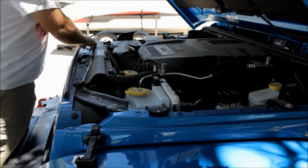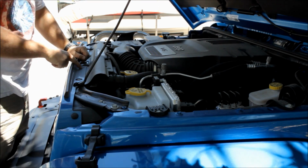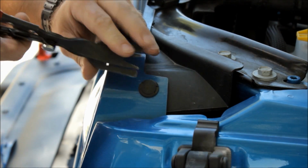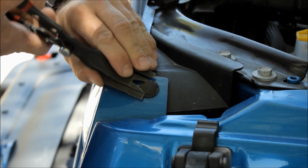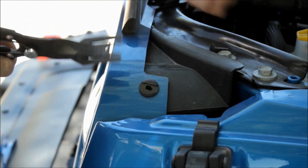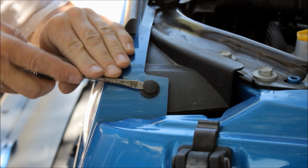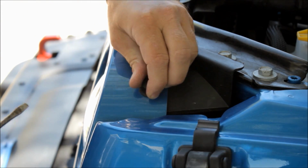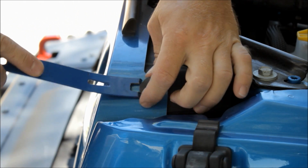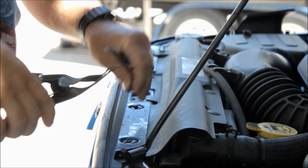So to install these lights, you're going to have to remove the front grille. I found it to be surprisingly easy on these JKs. There's these plastic trim pins, I don't know what you call them, but they have a little centerpiece, and if you've got a trim panel removal tool, you just raise up that centerpiece, and then the bottom easily slides right out. If you don't have one of those tools, you can carefully pry them up with a screwdriver, and then using the trim panel removal tool that I showed you how to make in another video, these things will pop right out. I'll link to that video in the description below.